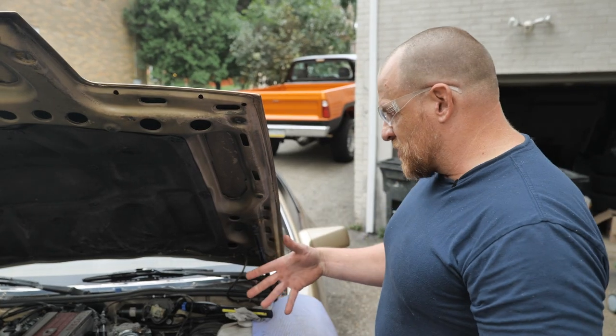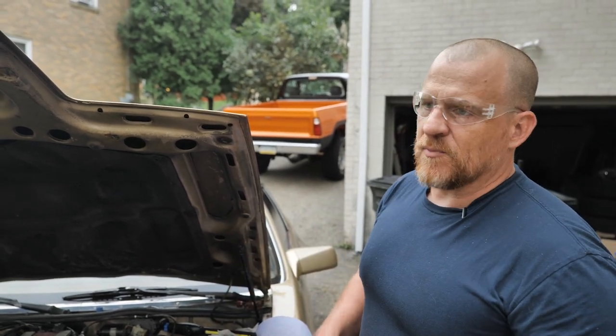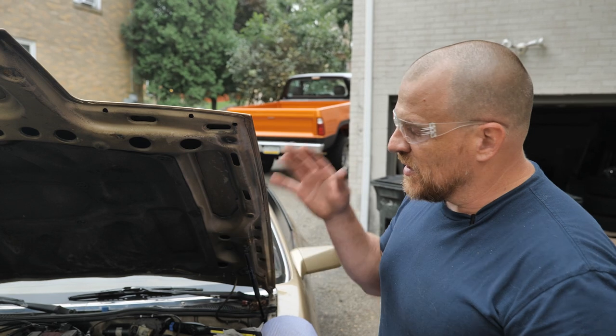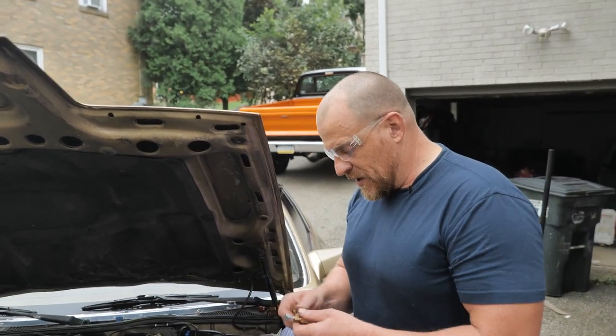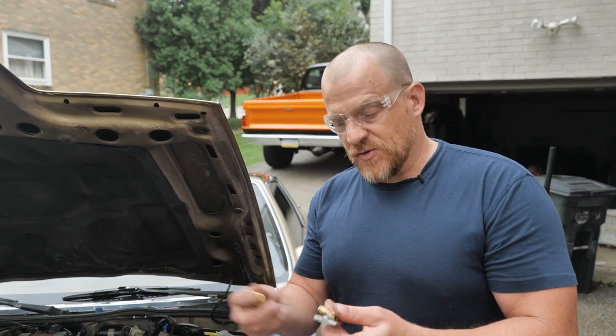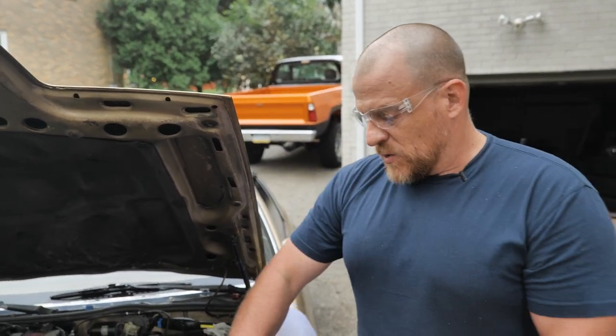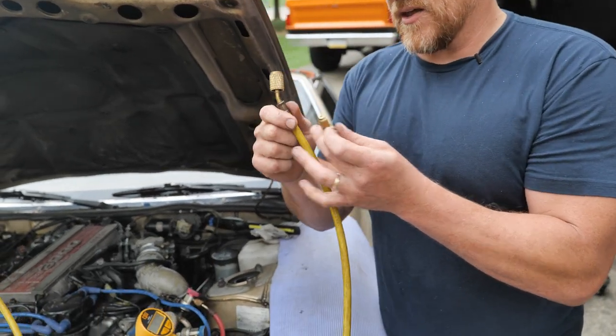I do want to do this one quickly. It's the end of the day. You guys saw how we charged it with hot water before. I'm not doing any of that. I'm charging it with the system. And before I do that, I want to address something that is concerning to many of you and the procedures that I'm using. Number one, we have a check valve right here, right? We don't want any atmospheric air getting in there.